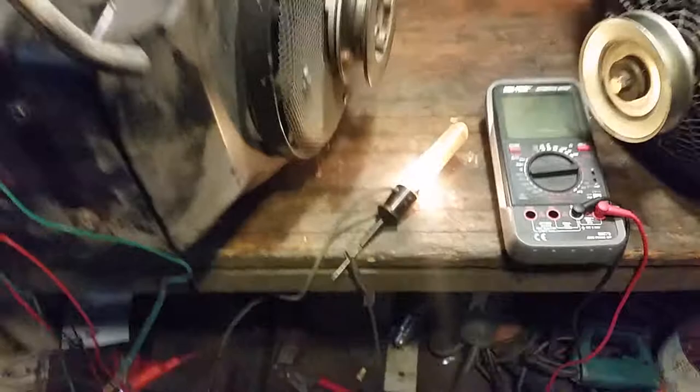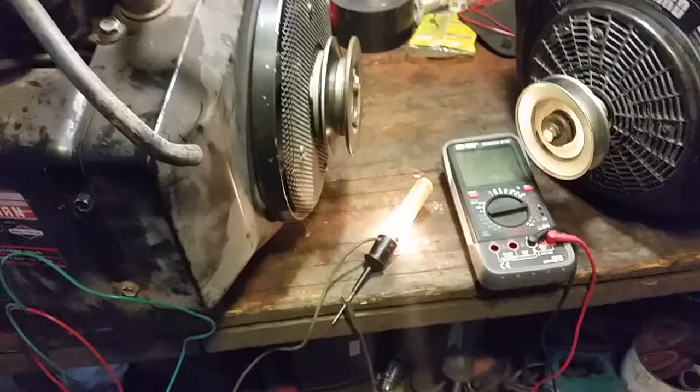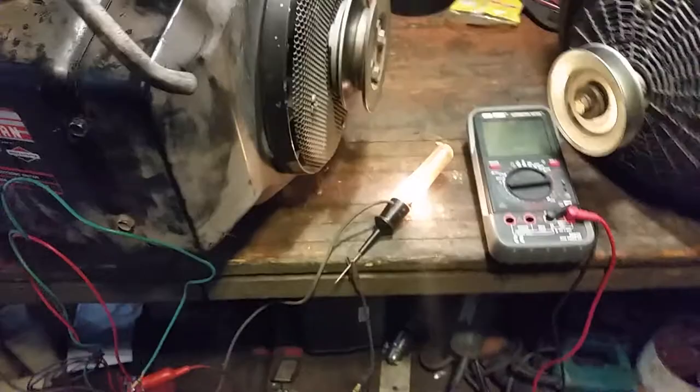The fuel relay is mainly used as a safety feature to arrest or shut the engine off without sending fuel into a muffler, in which case if you had spark killing an engine and it came back on, you could ignite that unburned fuel in the muffler. If you did want to hook up a safety feature, you could take this positive power and relay it through your safety switches on any particular tractor.